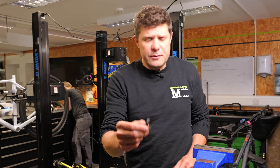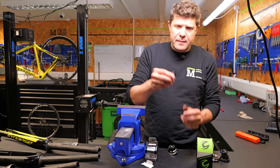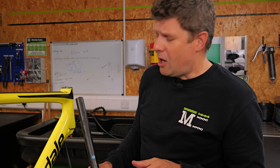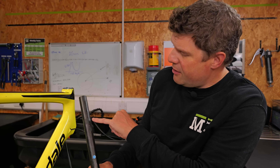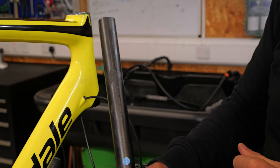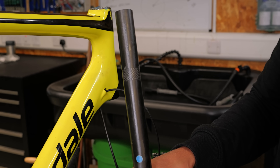In these cases, we take no risk — we get those repaired, make sure everything's in spec, and then replace the entire headset. We've just got this fork back from Carbon Reincarnation. Mark has essentially sanded down the damaged section, wrapped carbon around it, and brought it all back into specifications — so we now have the correct size steerer tube.